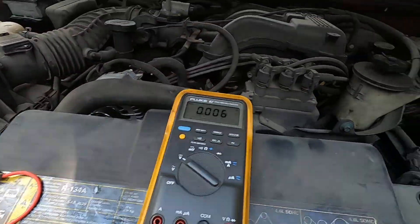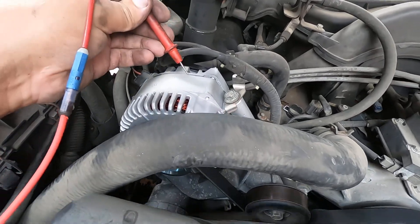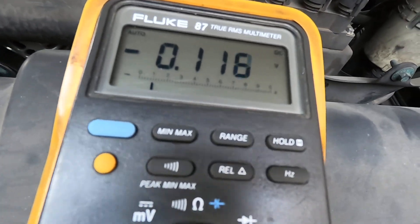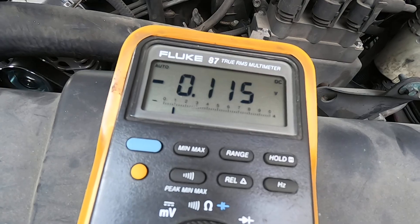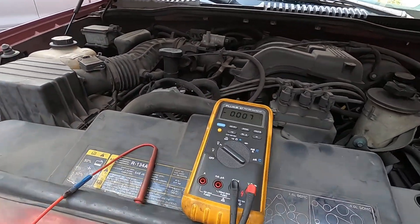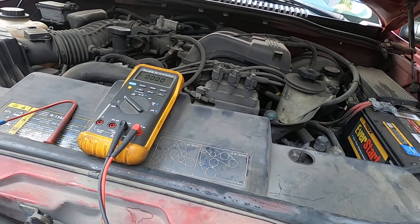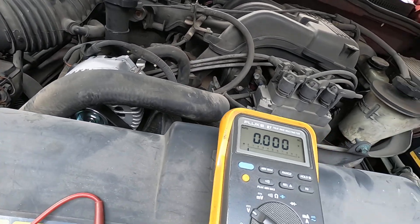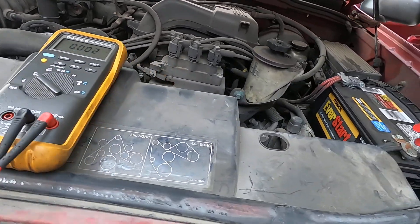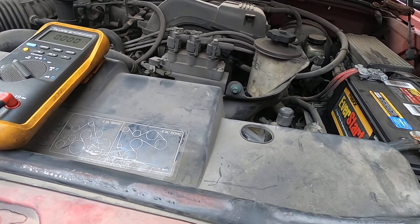Let's go ahead and do a case to the negative battery terminal voltage drop. I'm going to go to the case. It should be lower — that's 0.1 volt. The alternator's charging — that obviously was the fix for it. Battery light was never on, which is still puzzling — it should have been on. But for some reason, the PCM decided that it didn't want it on.